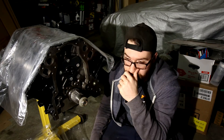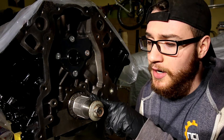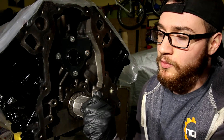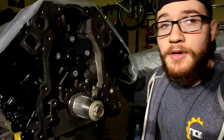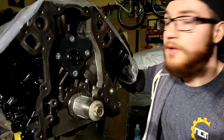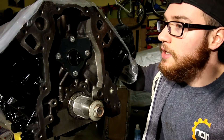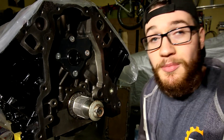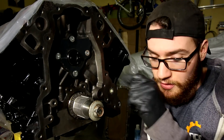In the clip of the indicator on the crank, the dot was almost at the 12 o'clock position. What we need to do is just turn it a little bit more. What we're doing is putting cylinder one at top dead center. I believe cylinder one is right here. Once we crank it a little more, this will actually be at top dead center — the piston, if you're looking at the front of the engine on the right side, it's the first one right where my hand is.